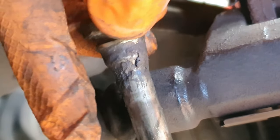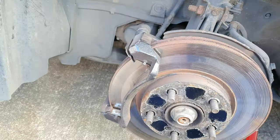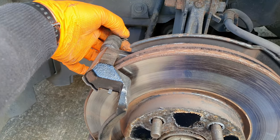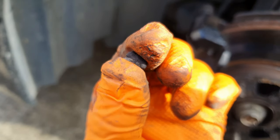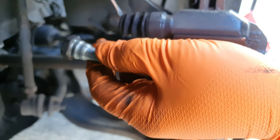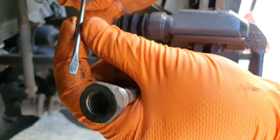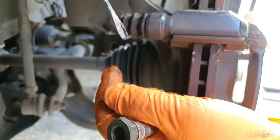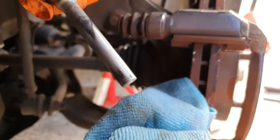They're sort of sticky - can you see that? My glove is sticking to it, it shouldn't be that sticky. So I'm going to clean off the guide pins and clean all this cylinder out, and put new lubricant on it. Just get a long skinny screwdriver with a flat piece on it - when you put it in here, you can scoop it around and take the goo out. All I'm doing is just cleaning off the guide pin, getting all that crap off of it.